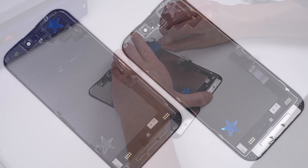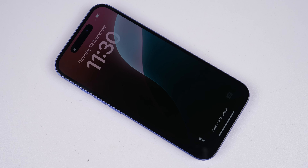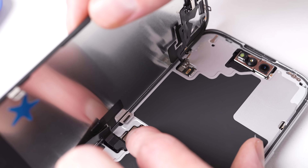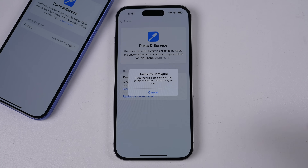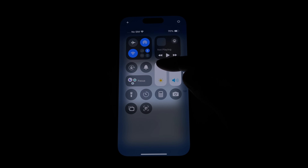On previous iPhones, failure to transfer this little cable could disable things like Face ID, True Tone, and Auto Brightness. So we'll install an unpaired new display with the phone's original sensor cable. When we do this, we see the 'finish repair' message, as it's identified the new display is genuine. However, shortly after, it turns into an 'unknown part' message and will no longer let me pair the screen. On the other phone, I tried pairing the display before it had time to identify it as unknown — clicking finish repair brought up an error message, and it's now also displayed as an unknown part, unable to determine if it's genuine. Meaning our new screen is running at a reduced capacity with the usual disabled features.